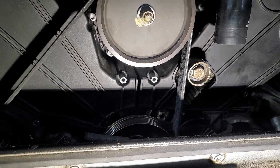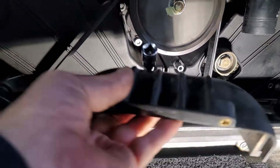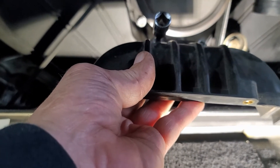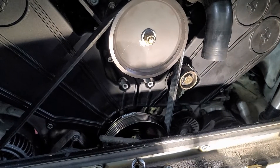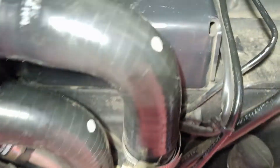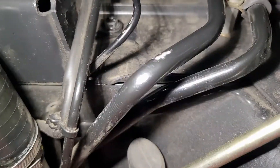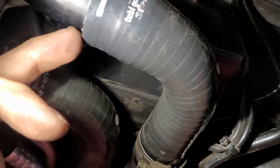At this time I'm going to install the upper center cover, then the lower cover, and then hook up the coolant line. Don't forget to install this filler piece — it's a rectangular box, secured with one 10 millimeter screw over there, with a standoff over here also a 10 millimeter. Your clamp for the water line hooks to that standoff, so don't forget to hook up the clamps on your water line.